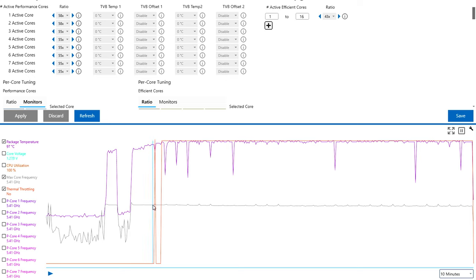It took about three to four minutes to hit thermal throttling, then you saw it pop back down, then a little more time, then throttle again. The interesting thing is the P-cores are staying right around 5.3–5.2 GHz, so we lost about 200 MHz. It was still always boosting up to 5.4 GHz, which is Intel's stock number. But a Cinebench score of 39,463 is bonkers — very, very incredible cooling from this thing.